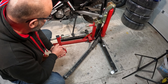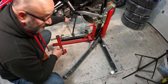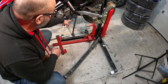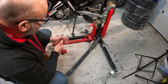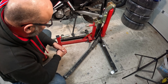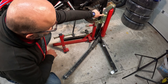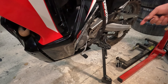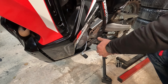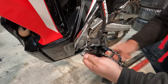So what I'm going to do now is show you how I fit it to the bike. The very first thing I do is put my motocross lift underneath the bike and just lift it up. I then have to take off this foot peg — I only have to do that because I've got the Zeta foot pegs, which are a bit wider and snag, so I just take this one off. The stock foot pegs don't get in the way. You don't need to take it off on the other side because this piece is longer on that side. Then I maneuver the stand in, put this piece on the far side, start pumping the pedal and it will lift. There are these holes here with a locking pin you put through — that holds it there so you're not just holding it on the hydraulic piston.